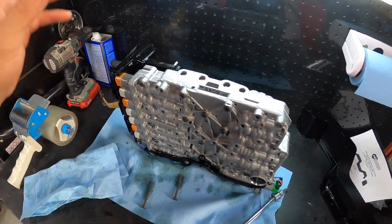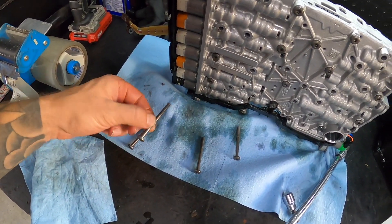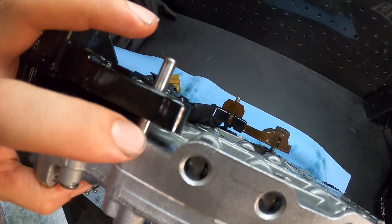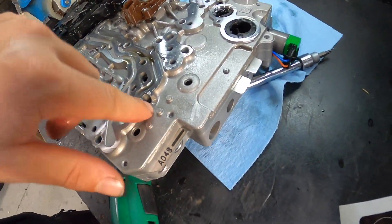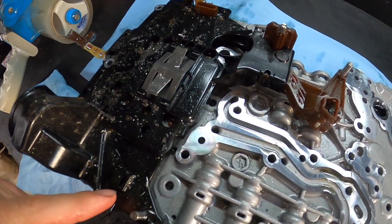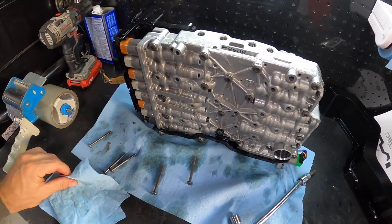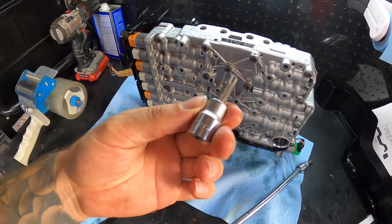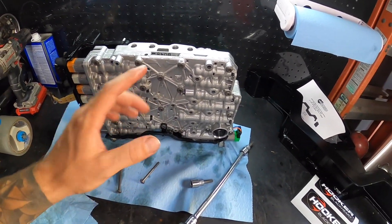Here it is. I'm just going to jump straight into it — it is possible. You have to remove a series of bolts, and how you're going to tell which ones they are: don't remove every single bolt off of your valve body. If you look, you can tell which ones need to be removed because you'll see them come through the backside here. Some of them are hidden but most of them you can see. This valve body has already got chunks out of it so I'm not too worried about damaging it. The valve body comes off the actual transmission by the larger head bolts — there are smaller torx but you'll see a larger one. I end up using a T40, and you'll remove all the large torx — those are the ones that hold it to the transmission.